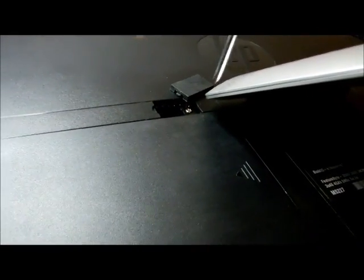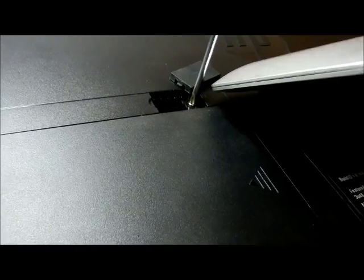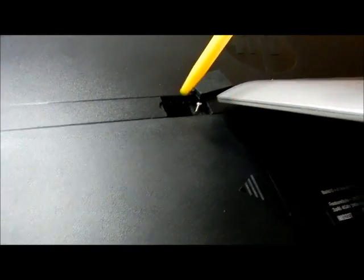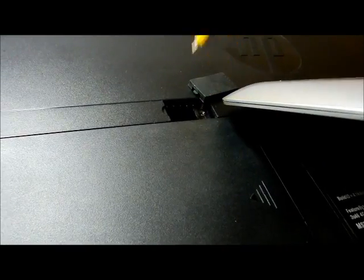we don't need to take out the RAM, but we have to take these screws out, including the screw down there for the CD-ROM drive. We do need to remove the CD-ROM drive. A nice useful tool to have is these mechanical fingers, so you can grab things like that and set it aside. Down on the bottom there is a really long screw. I'm going to unscrew that guy.